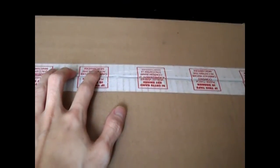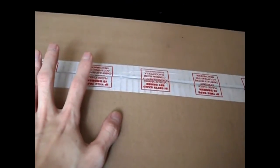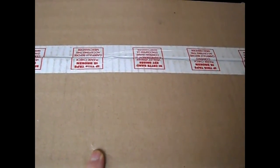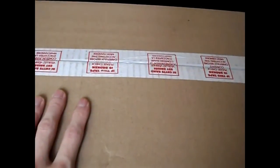Hello, YouTubers. My computer recently just broke down, and it's the power supply. I checked the temperatures on the computer and it's not overheating or anything, so the RAM and the CPU seem to be fine, and the only thing left is the power supply. During a high-end load, the computer will automatically turn off, so I have in here a new power supply.